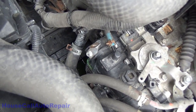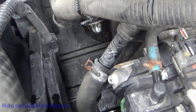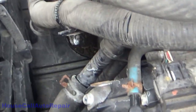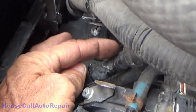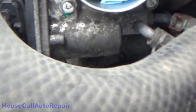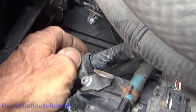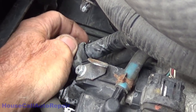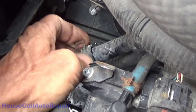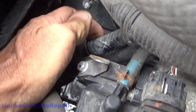If you look down there you can see all the green crystallized coolant, and if you look at the top of that hose it's wet right there. The reason I'm bringing you guys along for this is because this should be a recall. Watch very carefully — this is a plastic-coated metal tube that runs from the back of the engine. You guys see that? The plastic is moving but the metal isn't. What's happening is the plastic separates from the metal, the hose becomes compromised, and it starts to leak — and then the car overheats.